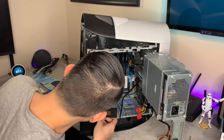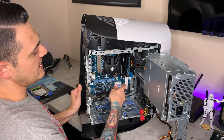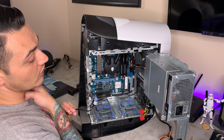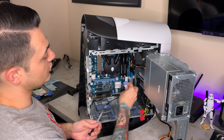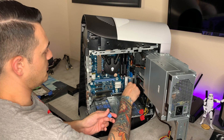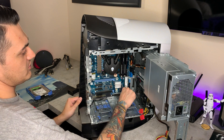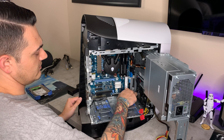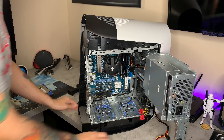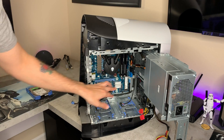This one is marked blue — it's SATA zero. Then there's one, two, and three. Since this one is a different color, usually what that means on a motherboard is that you have to utilize that one first or it will not recognize additional SATA drives. So unfortunately I was going to move this down a couple notches, but we're just going to plug that right back in. And this is where that fan is plugged in right here, which we're probably going to replace — so let's unplug it. It's a traditional four-pin slot, and that intake fan goes right here, labeled sure enough, 'fan front.'